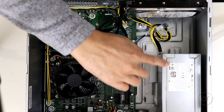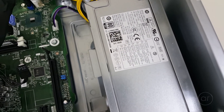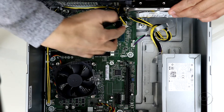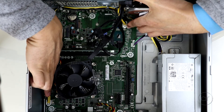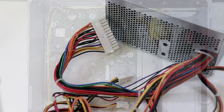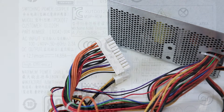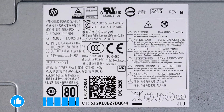Next, let's discuss the power supply. This is a 180-watt gold-rated power supply, which is just sufficient to power the existing CPU, motherboard, and components, and supports some upgrades to the CPU, memory, SSD, and additional hard drive. However, if you want to replace the PSU, be aware that this is not a standard ATX power supply. If you trace the power connection to the motherboard, you'll see it's not a standard interface — there are two proprietary 4-pin connectors attached to the motherboard, and there aren't any 12-volt power connectors for a graphics card. If you know what you're doing, you could splice cables of an off-the-shelf PSU to make it work, but otherwise you'll need an OEM power supply from HP. At the time of publishing, HP only sells an identical 180-watt replacement.